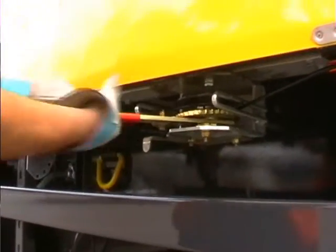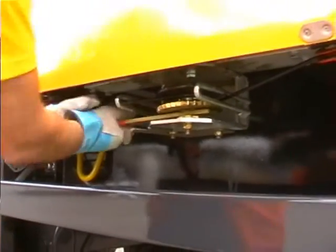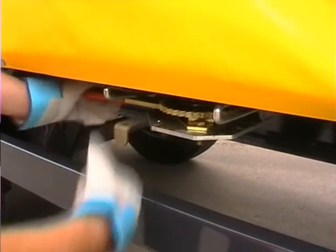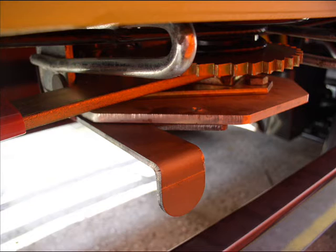Underneath the main ratchet lever, you will find a sliding lock device. Once the curtains have been closed and the cable tensioned, the driver can pull this lever forwards. This action aligns two holes through which can be put a security tag or other locking device. The curtains now cannot be opened without breaking this seal and pushing the sliding plate backwards.